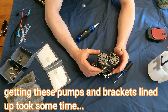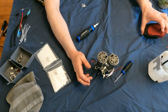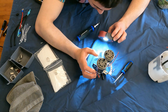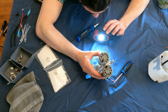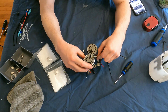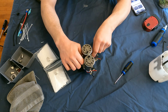It's all just bolted down now. I'm going to go around the edges and really make sure where your fuel pumps are going into this fitting that those O-rings aren't rolled or sticking out, because that would cause a whole big problem that you do not want. And we are just going to zip tie these pumps to our bracket.